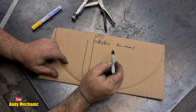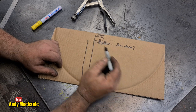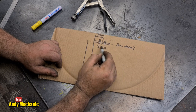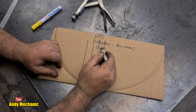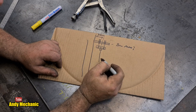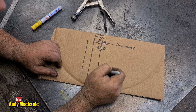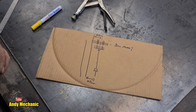We'll put the threads in there, and then the cables will thread into it, and they'll be really well located. And then from there, the inners will stick forwards. We'll have the two nipples just there, look. They will fit into a balance bar, like that, it's very simple. And then from there, there'll be a coupling with a bolt in the middle. Hopefully I've got some nice stainless steel 10 mil diameter rod that we can use with another coupling across here with a bolt to go through the handbrake. So all going to plan, something like that, maybe.